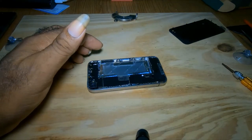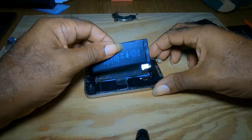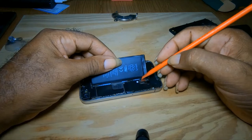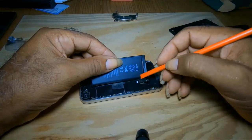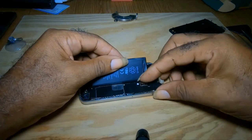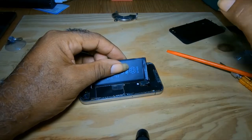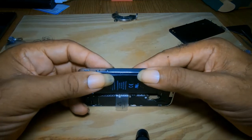You take your new battery and place it in. Put the battery on the side this way. Make sure you connect the battery first before you put the battery down in the housing. Use your finger and press so gently — you heard that clicking sound. Once you get it in and hear the clicking sound, which means it's entered, you put the battery down and make sure it's seated properly.